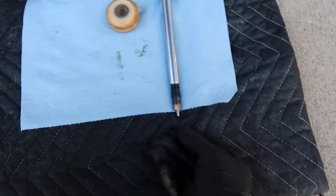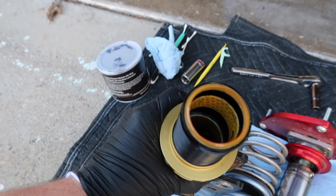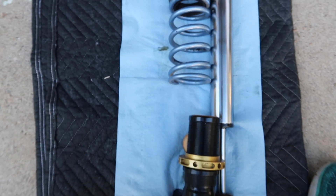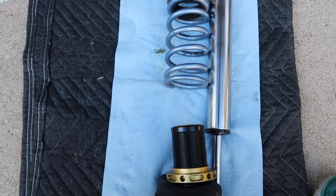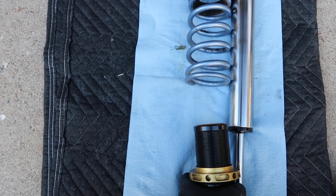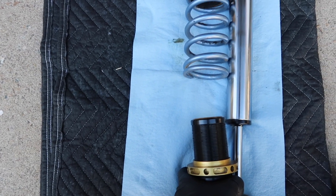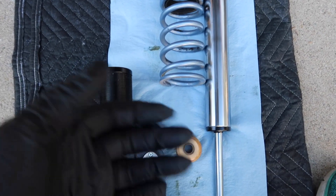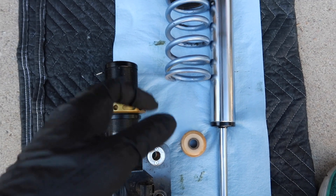So this is your strut housing, these are the springs, top hat, your adjuster goes down here, and there's a teeny tiny bump stop. What happens is inside here — those two black rings — that's where grease goes. As this sits inside, it'll actually bind up and get slightly off because the grease itself unfortunately acts as a bushing. It's a real good design feature, and if there's not enough grease you essentially don't have your bushing and it'll bind up, which in theory is what causes that popping noise I heard in the last video.